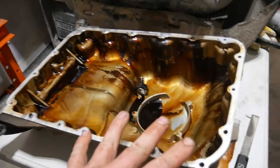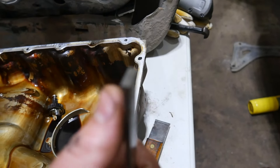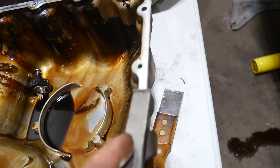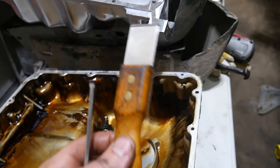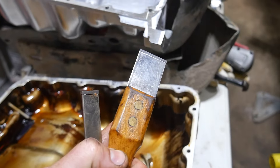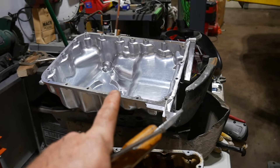On the engine side — you can see there was no silicone on this, really. This awesome little tool they make is called a super scraper. This is the small one. It's got a carbide tip on it — you don't want to drop them on the ground because they will shatter. It's super hard, and when you're using it on aluminum you just kind of go through and clean off that surface. Be really careful because it will gouge and nick up the aluminum. I also have a bigger one. Love these tools. We cleaned up the engine side, rinsed it off with some brake clean, wiped it all down so it's ready to go. We're going to test fit the new pan and then get our silicone on there.